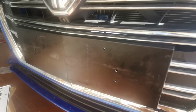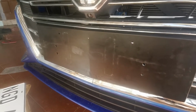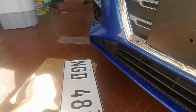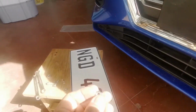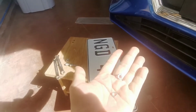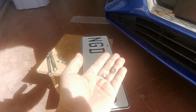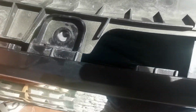It's very thin. I don't know, it might not hold the plate very well, so what I'm gonna do is put another washer on the other end there and use a nut to secure it. And there should also be a lock washer so that the nut would not rotate even if there's vibration. And the trouble is it's a bit down there. I don't know if you can see it.